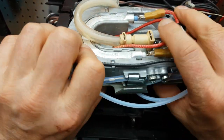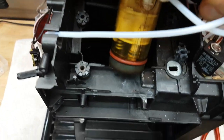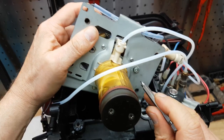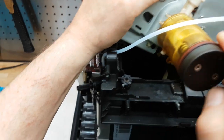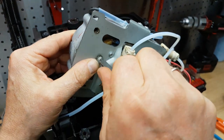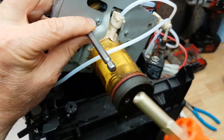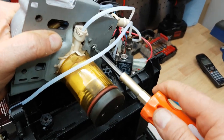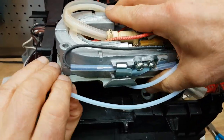This is loose — I think I forgot to screw the heating element back to the mounting bracket. Let's see if I can take this out without taking off the lines anymore. Yeah, that works. So don't forget that. Let's put the screws back in — two of them on this machine. Once I got them in I'll tighten them up again, put the handle back on my screwdriver so I can make them nice and tight.